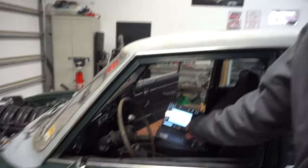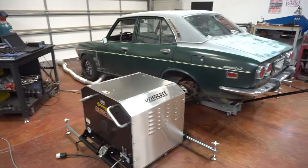I got the tuning laptop in there because Clyde's a little bit different with the 6L80E. I think I have to command it to stay in fourth gear. You want to make most of your pulls in fourth gear at 1-to-1. But otherwise, everything is set up and ready to go. So as soon as we get logged into this deal, we will hopefully make some pulls.